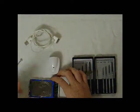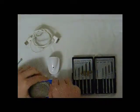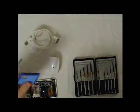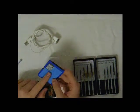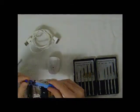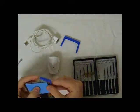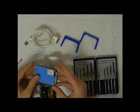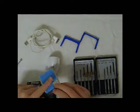And there is your hard drive. It's not really attached with anything except the cable here, so all you want to do is pull the cable out — straight out. That's pretty important. The hard drive has these rubber buffers and a foam pad on it. You're going to need to save the buffers most of the time unless the hard drive you're buying specifically states that it has them. Most of them come with the foam pad, so I'm not going to bother to take that off. Some will specifically say they don't come with the foam pad, and in that case you're going to want to very carefully take it off — you might want to use some glue remover, because it is glued down.